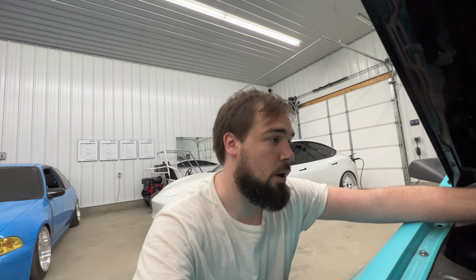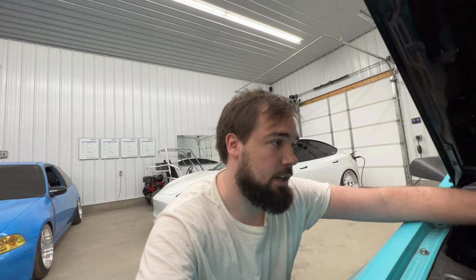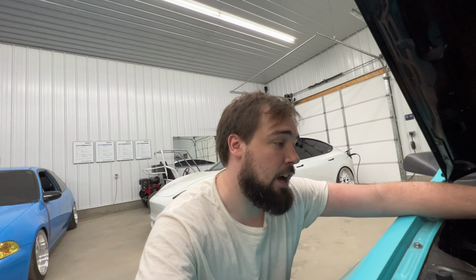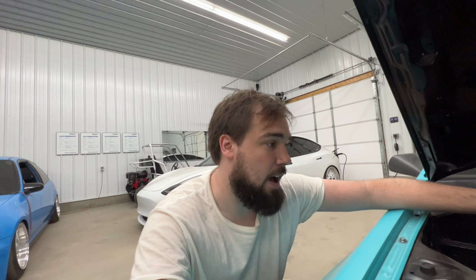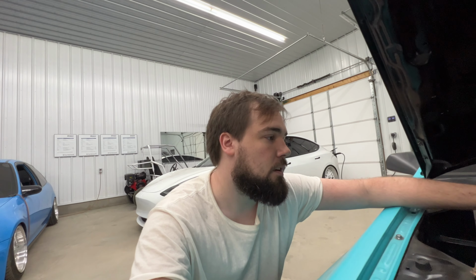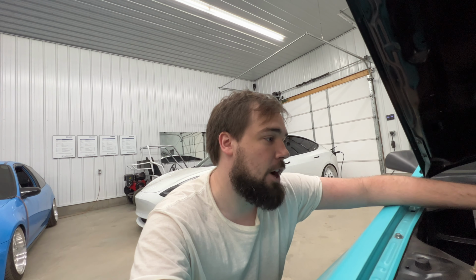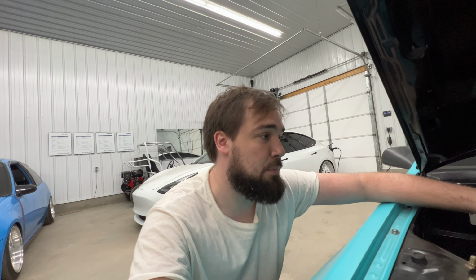We did at one point have it in one of the intake runners on cylinder 8, and it was leaning cylinder 8 out. So I changed PCV valves and I thought the issue went away, but apparently not. I think that with engines with low vacuum like this one, you maybe have to get a specific PCV valve. We'll have to look into that, but for now, I just want to make sure that my theory is right and that it is that PCV valve.